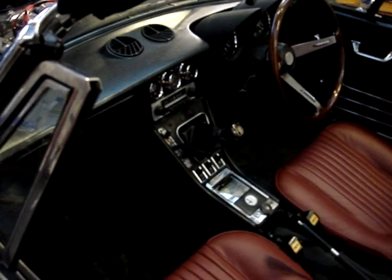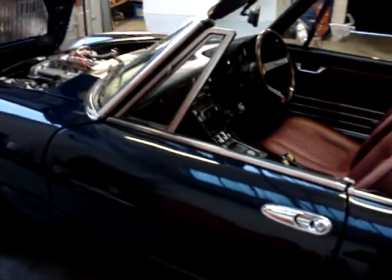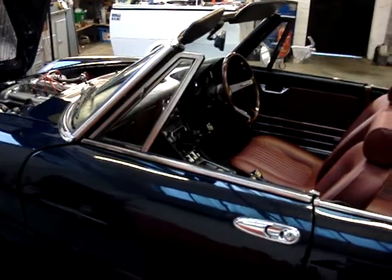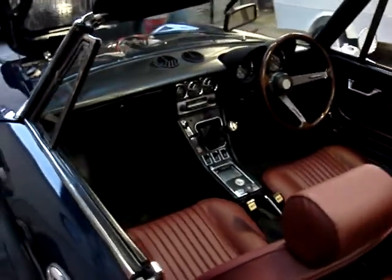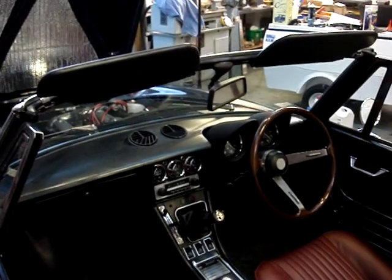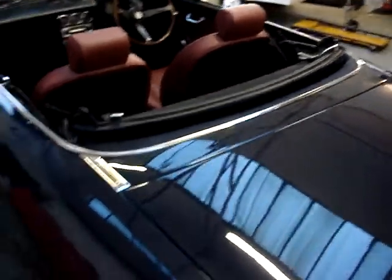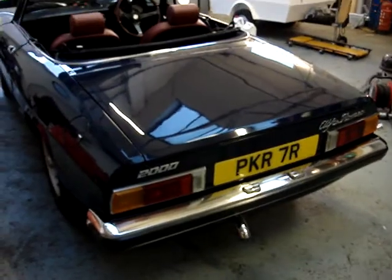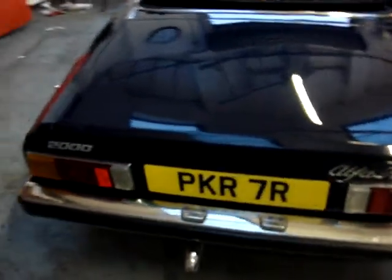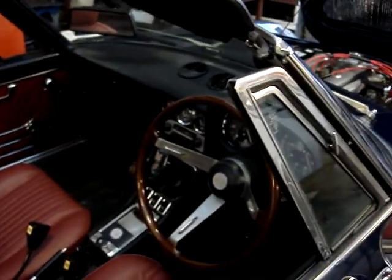The other problem we're having is the clutch. Now, I did mention that we needed a new clutch master cylinder and a new clutch slave cylinder, and we've got those and fitted them, and they both work. But we think the flexi line has collapsed as well, and it's quite common for the original flexi lines to do this. Again, it's unfortunate, but it's not something that you can know about until you actually put pressure through the system. Most of the time they hold quite well, but if it's a system that's not been maintained by a previous owner, then it tends to collapse, unfortunately. So basically we are waiting for a load of flexi lines to be delivered. All the lights work, all the electrics work. It's just really irritating that there's these tiny small things that have held the entire thing up. So they're going to be delivered on Tuesday.